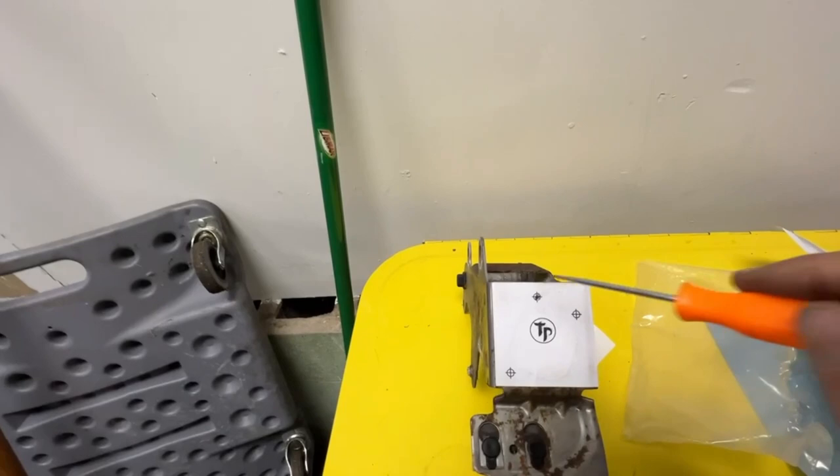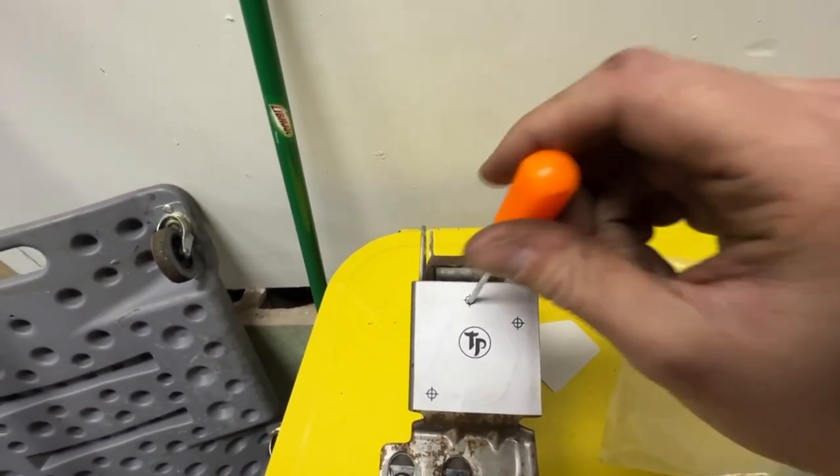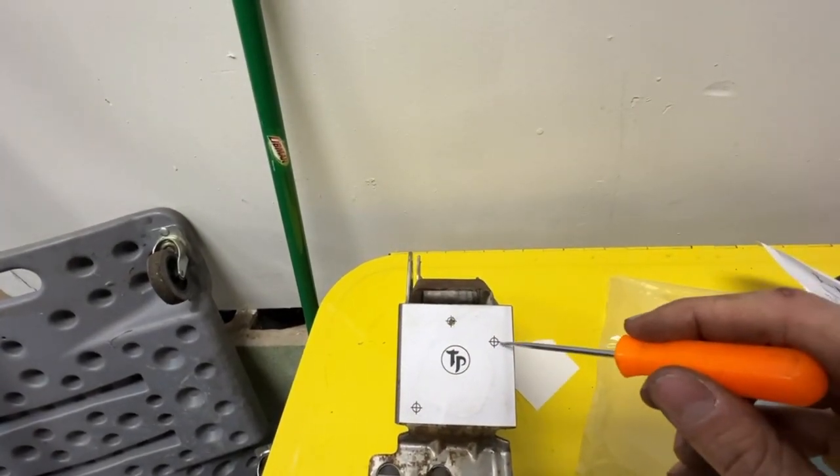The middle one is really hard to get to. You just gotta do like an eighth of a turn at a time, and then once it's loose you can barely get your hand up there to get the rest of the nut off. Here's the template. There's already a hole at the stock location — I just lined it up with that hole. Gonna drill two 3/8" holes here, punch it real quick, do a pilot hole, and then send it with a 3/8" bit — if I even have one, because I break drill bits all the time for some reason.